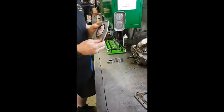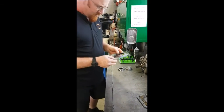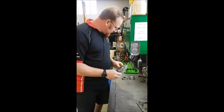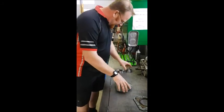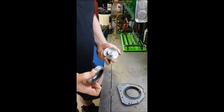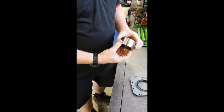The issue with that is you need the special tools to install it. You cannot fit that onto the end of the crankshaft without damaging it without the special tool. The tools we've got here are a tapered driver that inserts up onto the installation tool — they simply slip together like so.